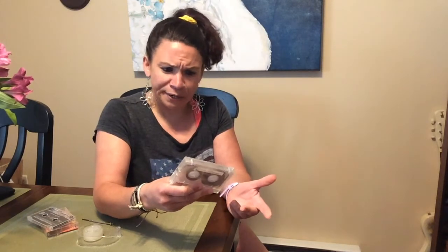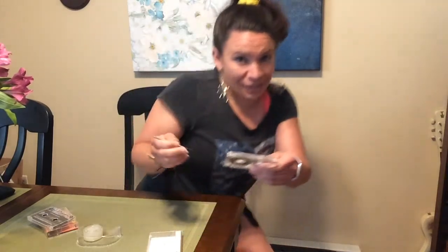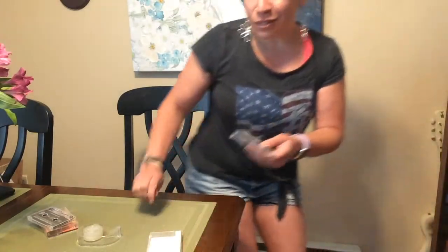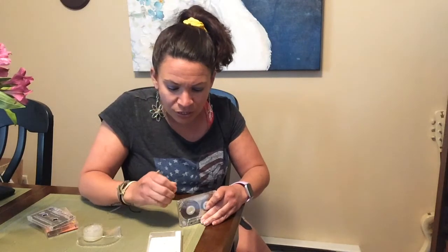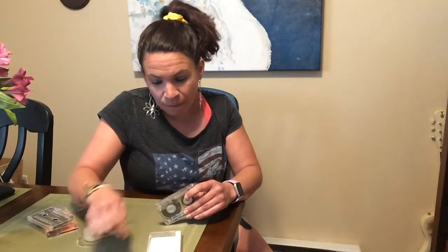Now the other way this goes: take Mix O2 — there's Moby, Poe, No Doubt, Incubus — pretty good stuff. I always check my mixtapes before I record over them. Look at the difference here: these squares are still in there, so that means it's recordable. Take your screwdriver and wedge it in — there's a little bit of a break — and just pop out those little squares. Nobody's going to mix accidentally over mix number two. It's protected now. They're going to have to make the effort to tape over it first, so it's going to be a decision, not a mistake.